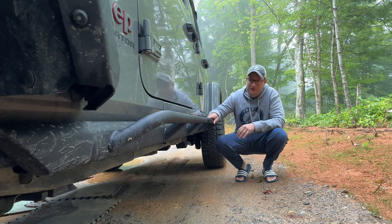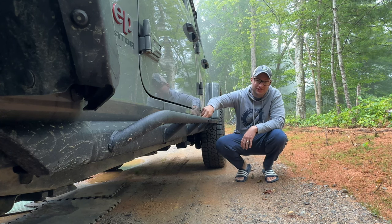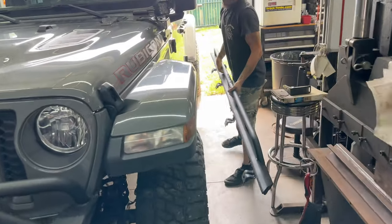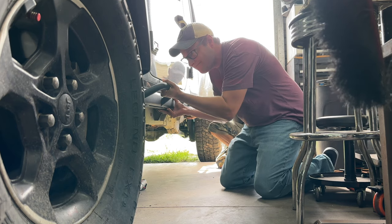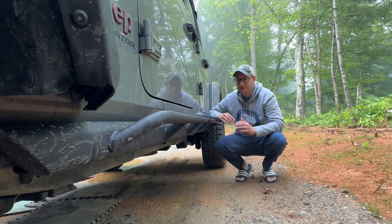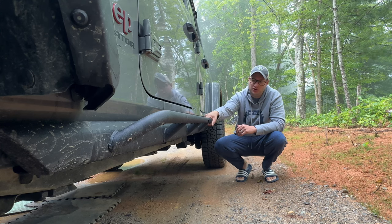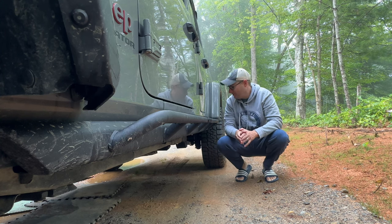Let's take a look at these rock rails. What Daniel actually did with these is he used the stock Rubicon base — the section running the whole length — and then he welded on this tubular rail. It saved him some effort, time, and some cost to me to use these stock attachments. I asked Daniel how much more work it would have been to fab the whole thing, and he said it would have been quite a bit more labor and time. So with the stock rails, he was able to add these tubes, which are super sturdy, and integrate them with the stock rail, which I thought was really cool.